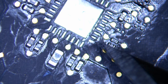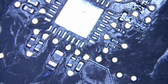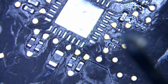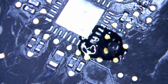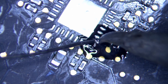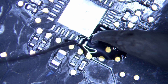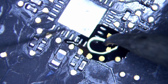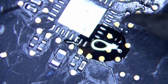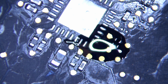What we need to do is clean it off and rebuild this trace. We can use some flux and a hot iron with solder to rebuild it. Rebuilding the trace gives the connectivity so when we put the chip back on, it will connect properly. You can get lazy and just try to clean it, but that isn't going to work here — we can clearly see there's damage to the trace, and leaving it as-is will cause problems in the future.